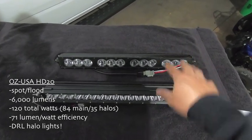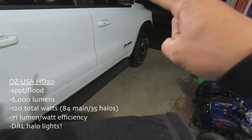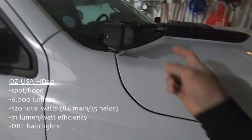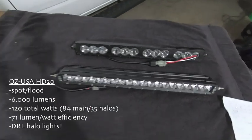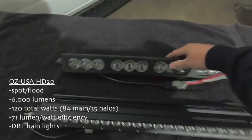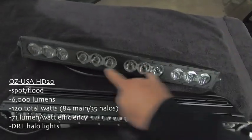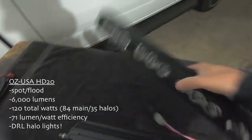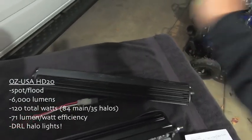What sets this light bar apart and the reason I originally went with it is because of the halos — that's a pretty cool effect. My OZ pods up top also have a DRL in the middle, so when the truck turns on the DRL lights come on above and below. This bar also has pretty extensive lenses: on the sides you have reflectors bending light out to the side, and the middle six LEDs are dedicated for the spotlight — basically a magnifying glass focusing light down the center — giving a hot beam in the middle with a nice flood on each side.